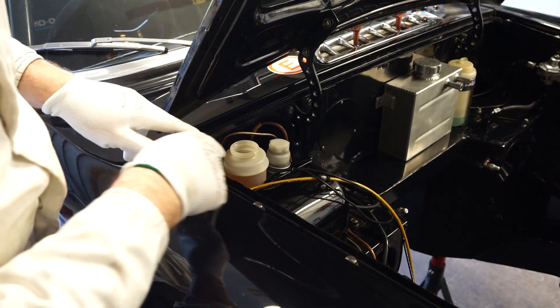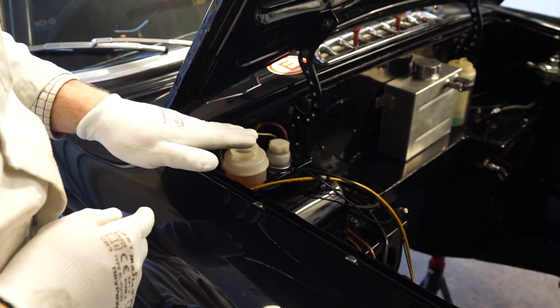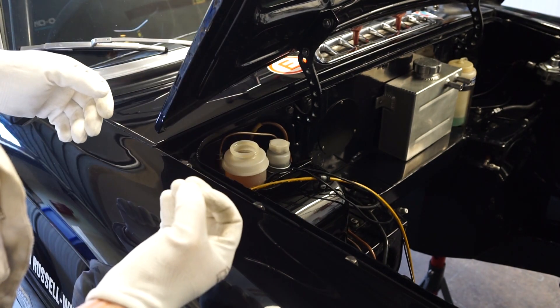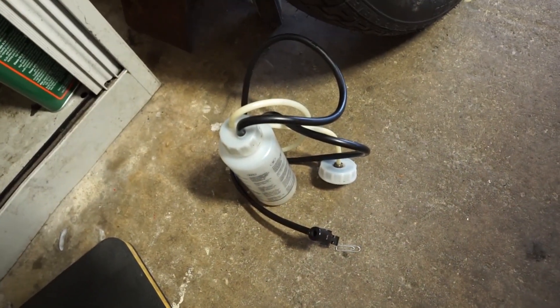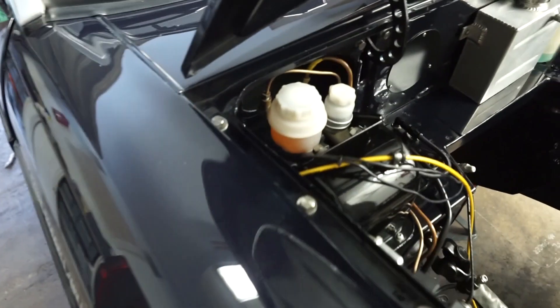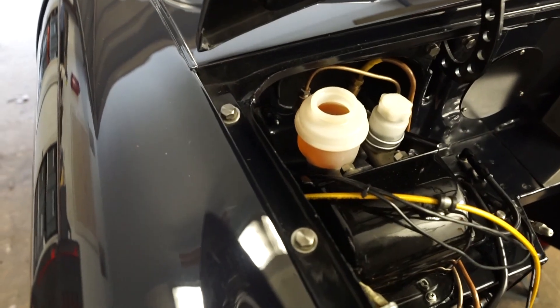You do need to be careful about how much you take out — you want to get towards the bottom of the reservoir but leave two or three millilitres of fluid at the bottom. You don't want any air to come in if it's too empty, and also when the fluid is down make sure no one presses the brake pedal and draws fluid into the system with air. Now we can get started connecting up the Gunson's Easy Bleed system. Before we actually fill the cylinder with brake fluid, it's worth connecting the whole setup first and checking that you've got no leaks. First take the cap off the master cylinder in the car and connect the Gunson's system to it.